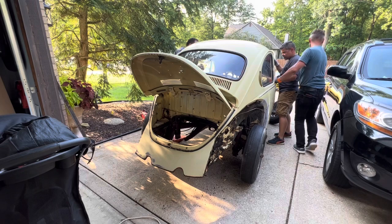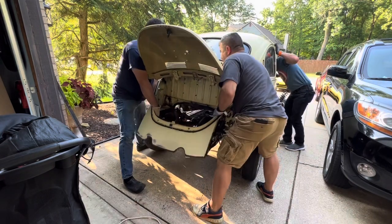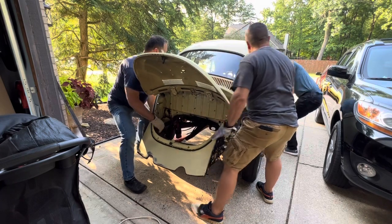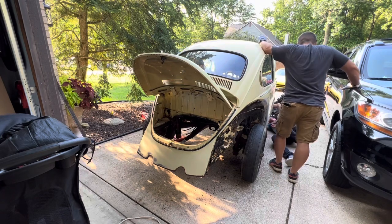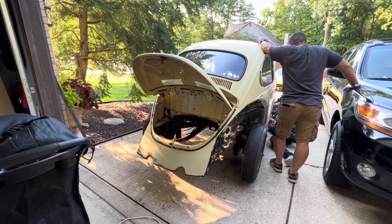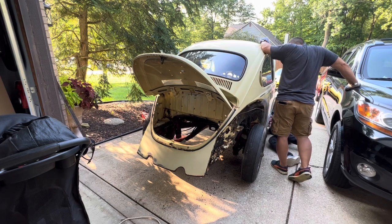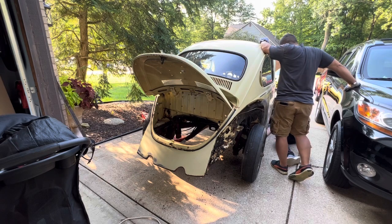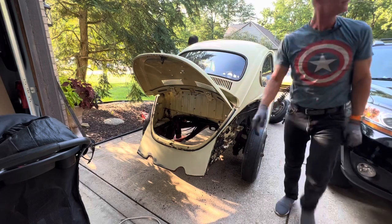We looked inside to see if I had forgotten to break loose any bolts. Repeated the process a couple more times and checked the car from side to side. Finally, I lay down on the floor as well as my other buddy, Rafi, and I came to realize that I forgot to remove one of the bolts from the passenger side, and Rafi noticed that I forgot to remove the two front bolts from the front head that fasten the front end of the shell to the floor pan.